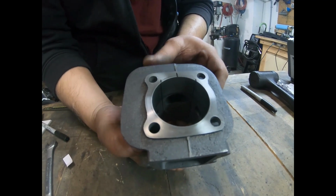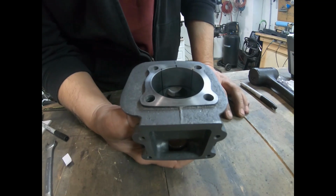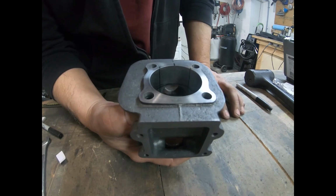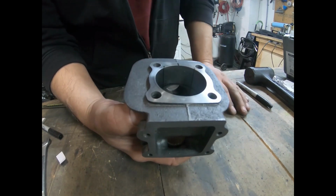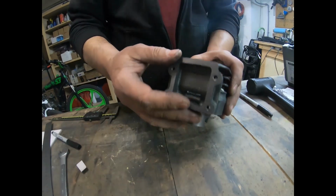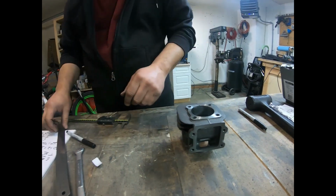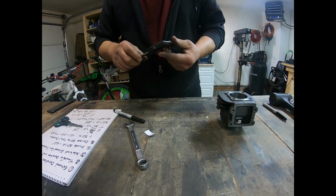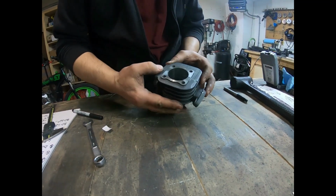All right. So that there is just giving me 33 millimeters wide on the degree wheel. I moved the exhaust up by 1 millimeter, 3 degrees. In total, it's 6 degrees from total exhaust duration. Okay, which is going to head me up to, I think, about around 19 degrees blowdown. Okay, so that's going to be part of my porting that's started out.